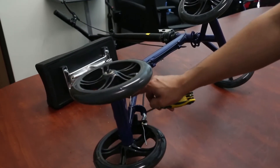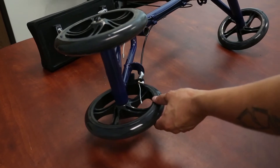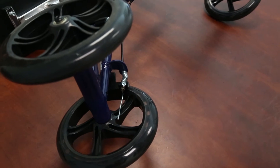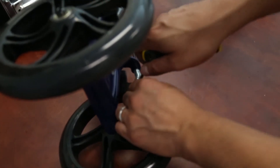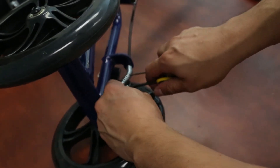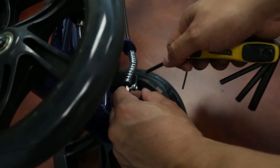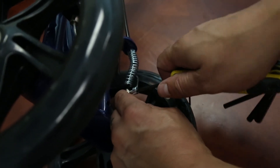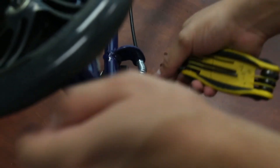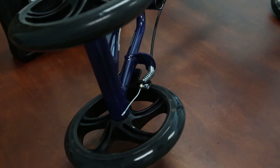In the off chance that the brake is touching the wheel without the handbrake being engaged, what you would do is loosen this with the allen wrench that it comes with. Just like a bike, the spring is going to push out the wire, so just give it a little bit more slack. Once you feel it moved a little bit, tighten it back up and you'll see that it spins smoothly. You might have to do this a couple of times just to test that the brakes work correctly.